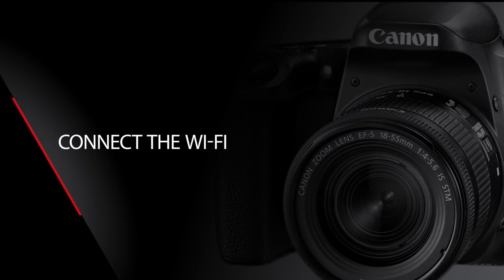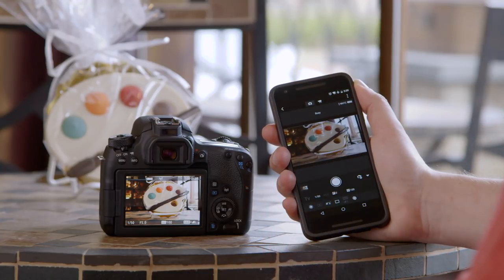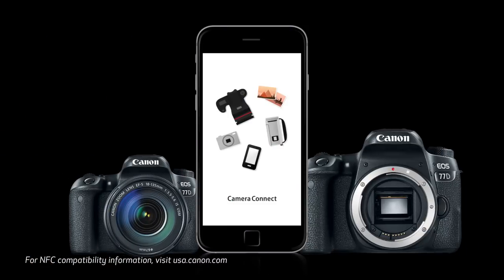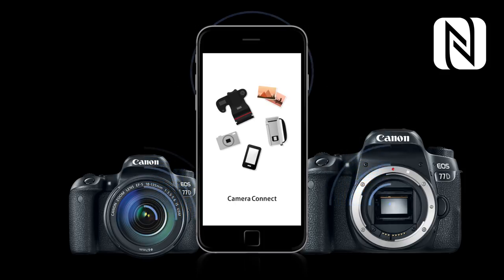Next, you need to connect the stronger Wi-Fi wireless communication between the EOS 77D and your smartphone. It's these stronger Wi-Fi signals that will be used whenever you view or download images to your phone or remote-control the camera. If you're using an Android device with NFC communication, you can usually just hold the left side of the EOS 77D up to the NFC contact area on your device — after a few moments, the phone's screen will display a few quick setup steps and Wi-Fi is connected. For the rest of us, you'll need to set up Wi-Fi via the Camera Connect app and your camera's setup menu.